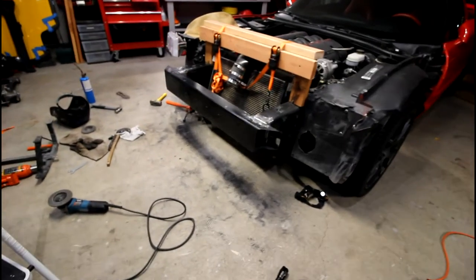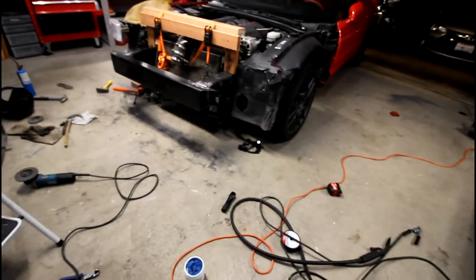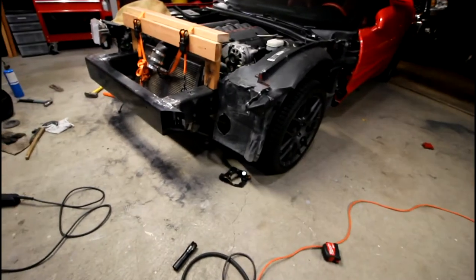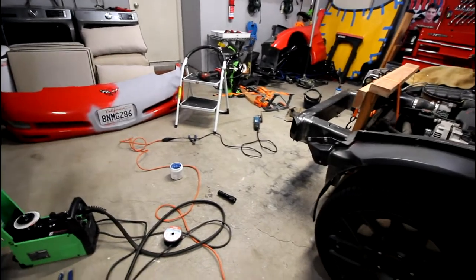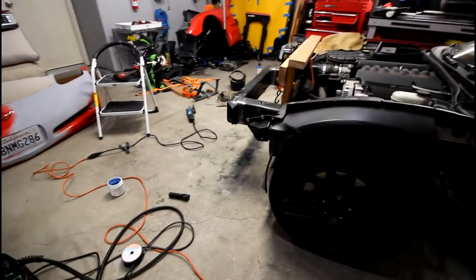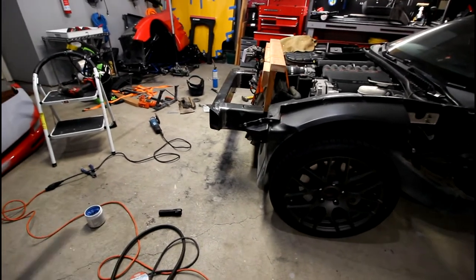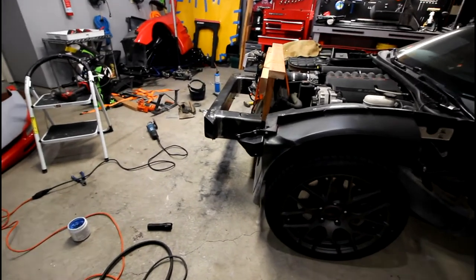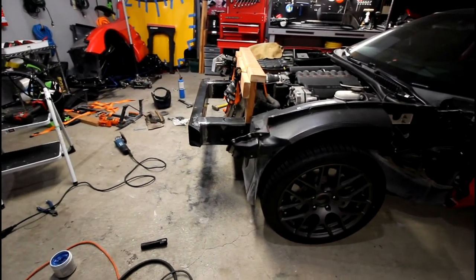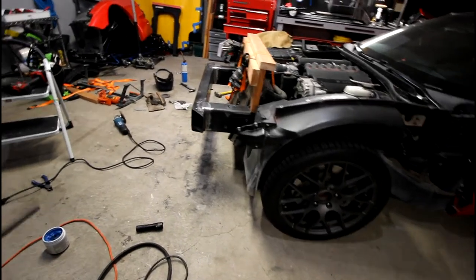After much work the welding is finished. I ran into a little issue with the welder — the welding wire got tangled for some reason, which cost me a lot of time. As you can see it's dark now, so I've been working on this for a long time today. Overall I'm really happy with how the welds turned out, given that I'm still somewhat intermediate slash beginner and I've just got a basic entry-level flux core wire welder. I was pretty happy with how the welds look and how well they penetrated the metal. It's pretty thin stuff — 16 gauge — so it doesn't take a lot to get a deep penetrating weld, but this is definitely going to be strong. When I pulled the original impact bar off the car for the first repair, these welds look very comparable to how the ones from the union auto workers on the assembly line looked, so overall I'm pretty happy.